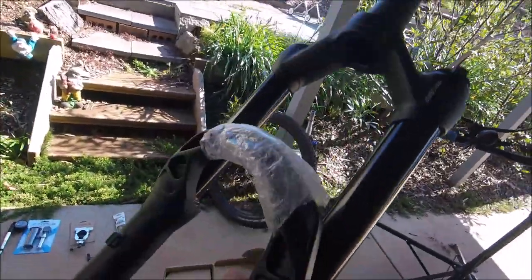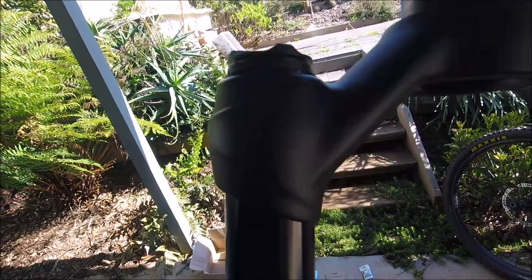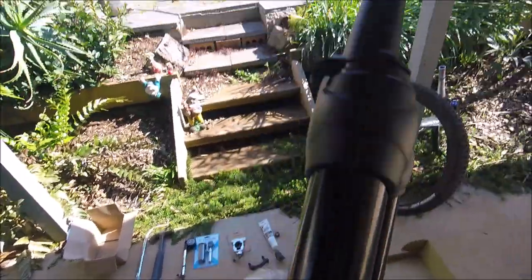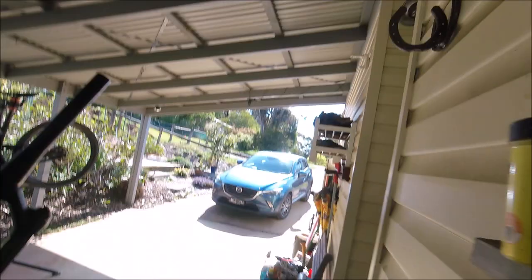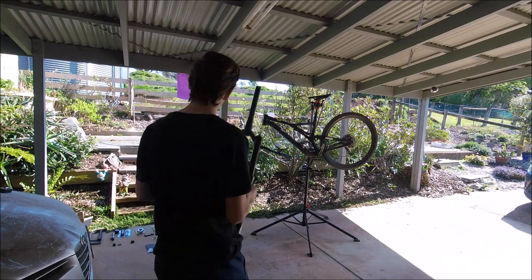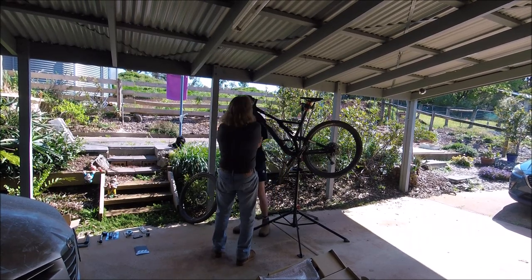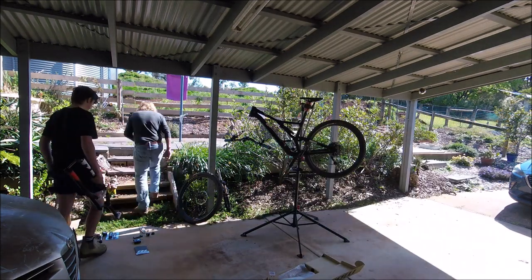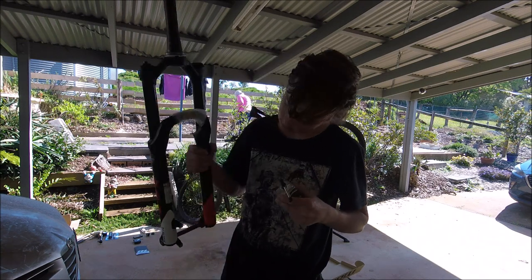Got your rebound adjustment. You've got the nut for taking the fork apart. The reverse arch, which is pretty cool. Those slanted bottom-out bumpers — well, that's not where the fork actually bottoms out — it's 140 millimeters of travel, 29er plus, which is pretty cool. Clamp it in this, hack the steerer tube. Now file it, make sure it's all nice and smooth and take off the burr. Then put it in the bike, install the brake, and we're ready to go.